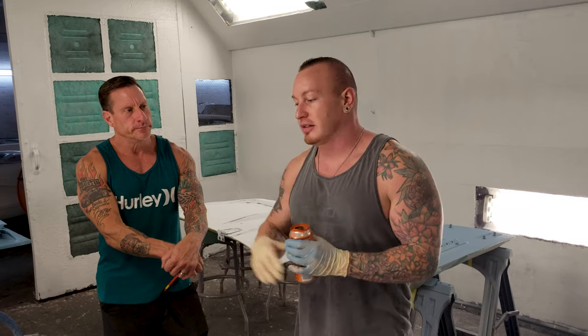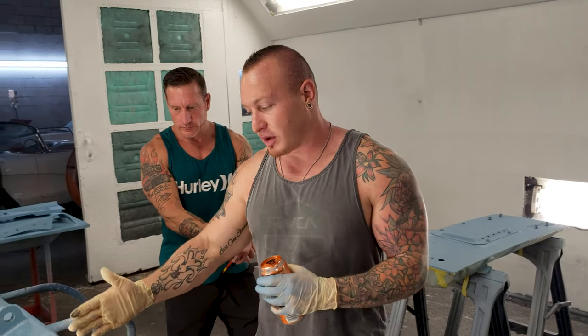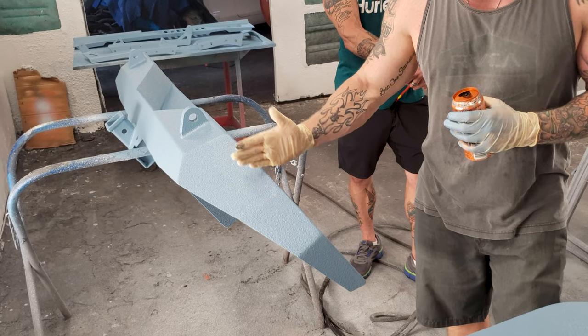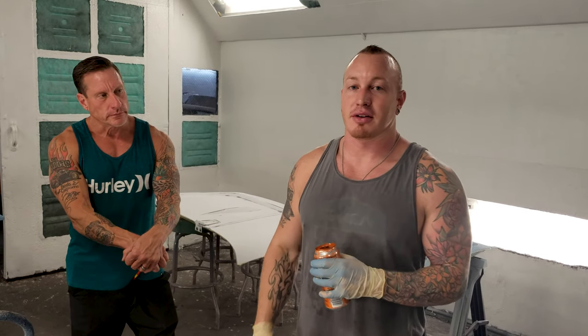They're not. So what we do is take all of these bumpers, whatever brand they are, and we match them literally with 3/16 plating and welding, cutting, grinding. We do all template design with cardboard, mock them up. So everything from about here over has all been one-off fab for this Jeep, mocked up on it so that it lines up exactly to the fenders that are designed on that Jeep right now.